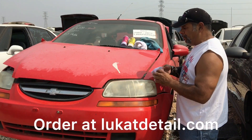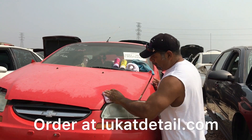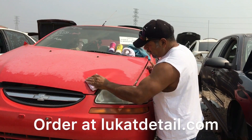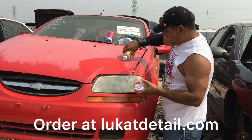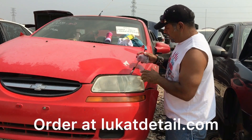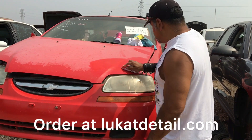I'm going to use a terry cloth towel and I'm just going to clean — I'm not waxing, I'm cleaning. I'm cleaning right where the clear coat is, right where the base coat starts. If you clean it, you can make it shine again. This is not a cutter — it's designed to clean chemically. This is the dead paint that's chalky and flat. What you see there is the good remaining paint job.